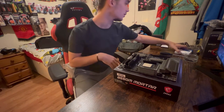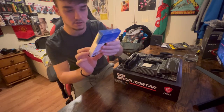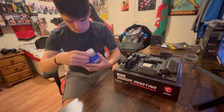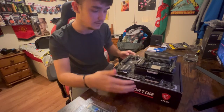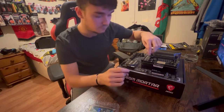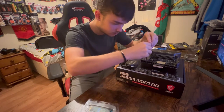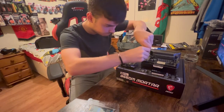Once you've done that, grab your SSD. I've gone for the WD Blue SN570 M.2 SSD with one terabyte of space. I'm still gobsmacked by how you can fit that much storage in something so small. You want to find where you're going to put the M.2 SSD. On this motherboard there's a slot with a heatsink over it which says Lightning Gen 4 M.2. Grab your little screwdriver — after some research I finally figured out how to unscrew the nails off the heatsink.